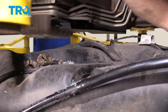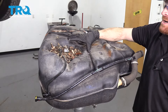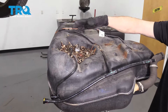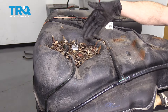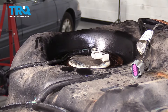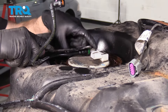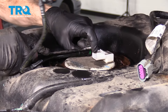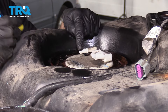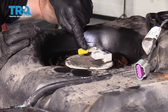Now we can completely lower the fuel tank. Typically when you drop your fuel tank down you're going to see a lot of debris on top — in our case it's an extreme example, so vacuum it off the entire surface. Then continue by removing the fuel pump assembly. Remove the remaining fuel line by pressing in on the green tab and carefully pulling it off. Inspect it and set it aside. Use the connector port from the new fuel pump to plug off the old pump temporarily.